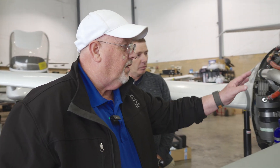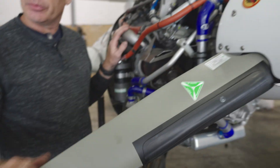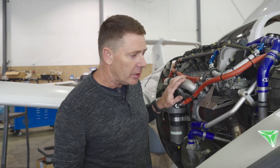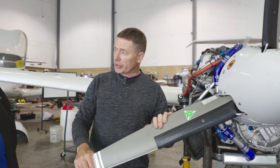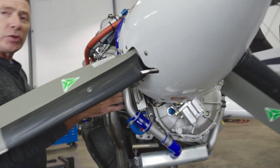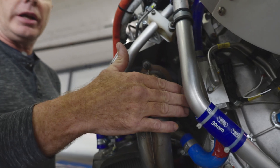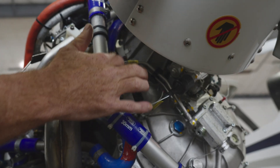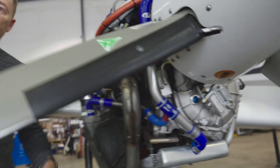This engine has a gearbox — it runs up to about 3,900 RPM. The gearbox makes the propeller more efficient by slowing it down, reduces noise, and provides more torque. The gear reduction ratio is 1 to 1.69 — I think it's 34 and 23 teeth if I remember right. Up front we have a gearbox oil pre-heater. The blue lines are hot liquid coolant running through this engine. We take that hot coolant through the gearbox oil pre-heater to preheat the gearbox oil to 60°C before we fly in winter.